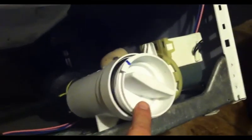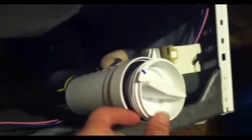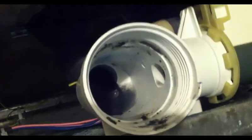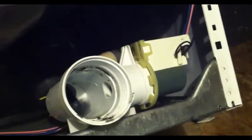I got the front bottom panel off and there is an access port here - it's like an emergency drain slash lint catcher. Unscrewing this thing we can see what the problem is - it's just full of crap. These are color catchers - you can see the box of those things earlier in the video. They've accumulated inside there. I'm pretty sure the pump is fine but these color catchers are the source of the problem. This smells rancid but I'm going to clean this out - I think we might have found the culprit.